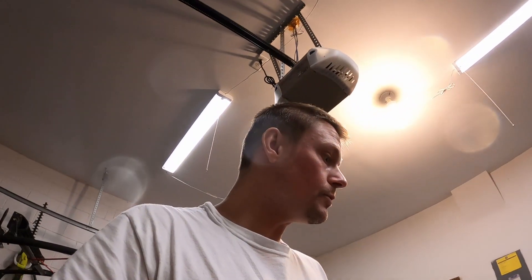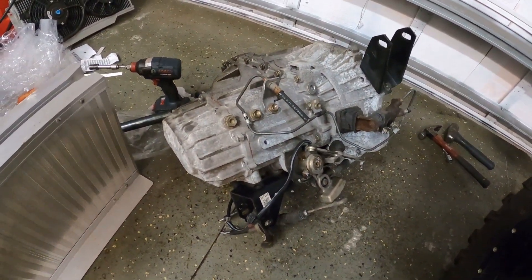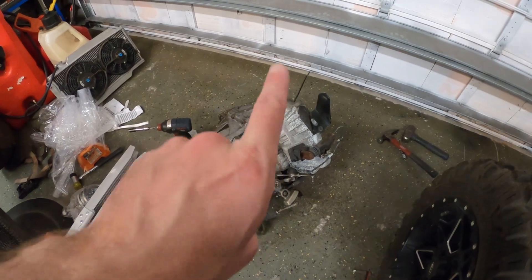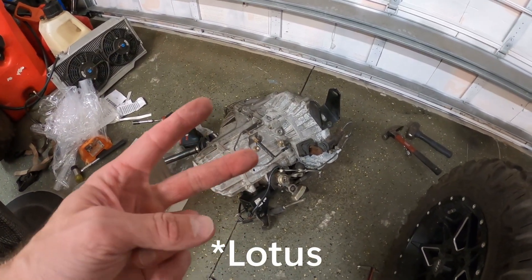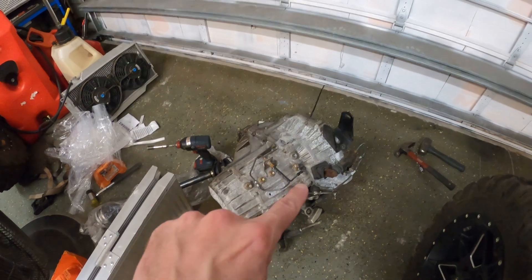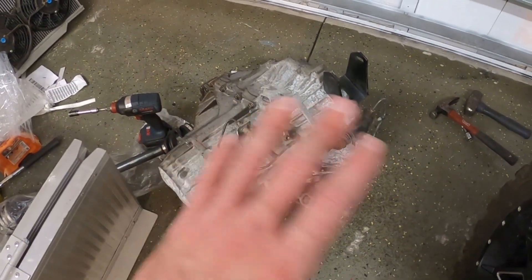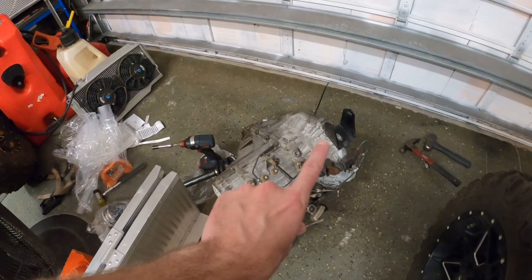So what are we doing to fix this buggy? Let me show you the new transmission. This is a Celica GTS transmission — it's a Toyota C60. For you performance guys into the MR2s, Celicas, and Toyotas, you're probably already familiar with this. Between the C60s and C64s, they're very desirable transmissions. The biggest reason they're popular for the aftermarket is there are stronger gears available, LSDs available — all kinds of good stuff that I didn't have capabilities for with the old transmission.